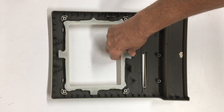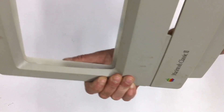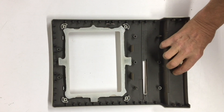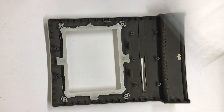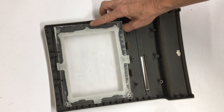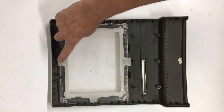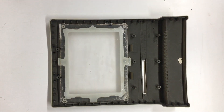Let's do a run-through on how this gets installed. First, we install our interface and make sure it gets lined up — it takes up the gap so well. Once the interface is installed, we lay down our acrylic plate. You go ahead and screw the interface to the acrylic using the top tab and the bottom tab.